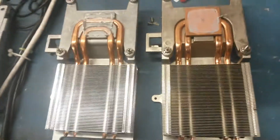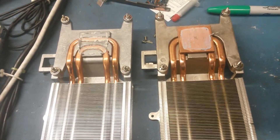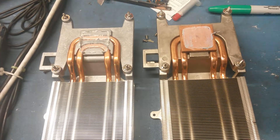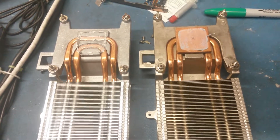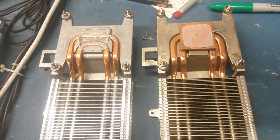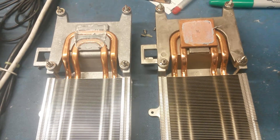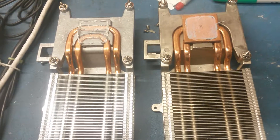The problem is a fake or Chinese heat sink. Notice the one on the left — fake. The one on the right is the correct Dell part number. The fake one on the left is making the unit completely overheat and shut down, not getting enough coolant.